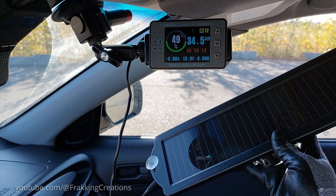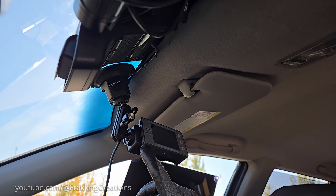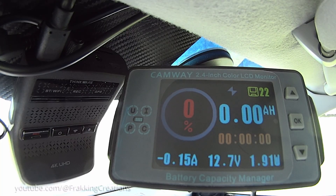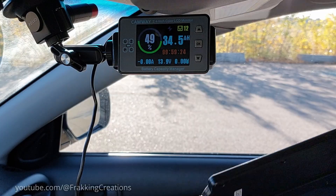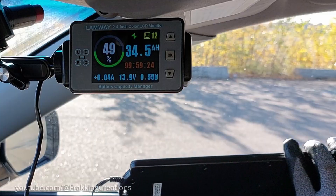Let's see what happens if we use this small solar panel. I already have this battery monitor connected to the vehicle's battery, and this Thinkware dashcam is connected to it. With this setup, I can monitor how much power the dashcam is using from the battery. If I then connect a solar panel too, I can see if it's helping to power the dashcam so that less power is used up from the battery.